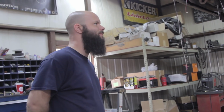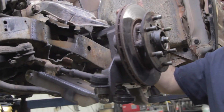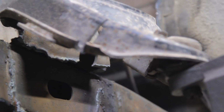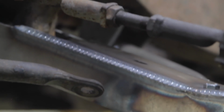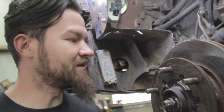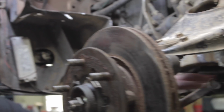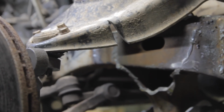And of course, we're gonna get rid of everything on the upper control arm. We'll just build our own tabs with alignment abilities in the top, and get rid of our nice mini truck high cut. Other than that, bonanza. So next week we'll tackle the upper, probably make a tube style control arm, raise it just a little bit because I like to ride low. Pocket the frame for that 2,600 pound airbag. Just mount a shock, get it finished.